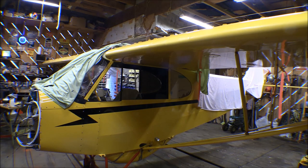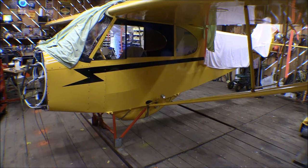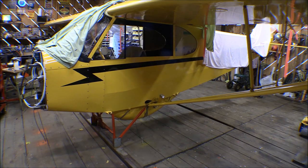I don't have all the nuts and bolts torqued down to specs yet on the wings. I can go up now and torque down the bolts in the hinges where the spar attaches to the fuselage, but I was waiting on the upper spar bolts until all the aileron cables are mounted. The bolts on the bottom that attach the spar struts to the fuselage are in, but I don't have the nuts yet. I talked to Jim, and he's going to pick some up at Spencer's Aircraft and bring them when he comes.